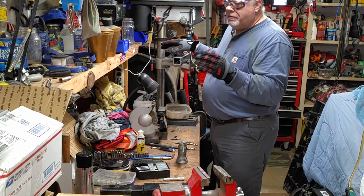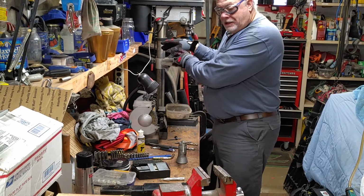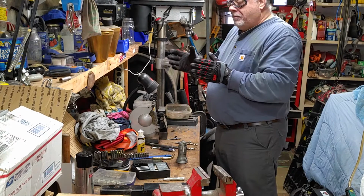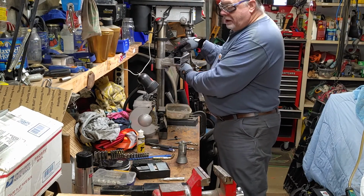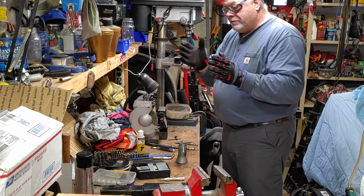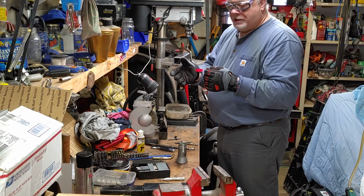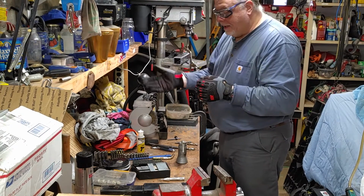And the harder the metal is, meaning this steel versus, say, stainless steel, you've got to start off with a very small bit and work your way up in smaller increments, because there's a greater risk of breaking that bit, versus this type of steel, which is a softer steel. You can go in larger increments between bits. Like say you grab one bit, you go 2 sizes up. That you would do on a stainless steel. For this, I'm doing 1 bit and I'm going up 4 sizes to the next bit.